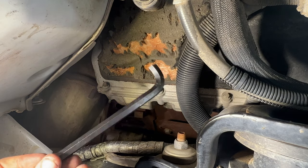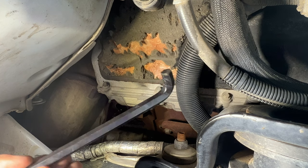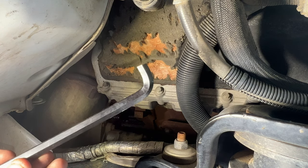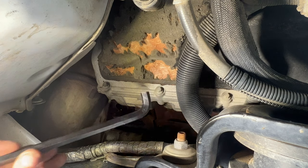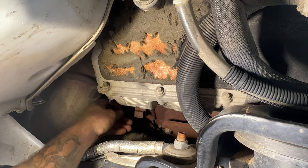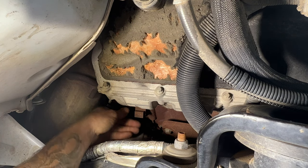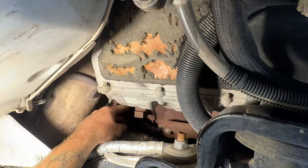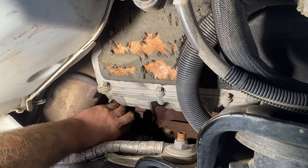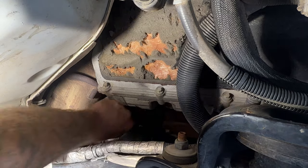So it did loosen up a little bit at least. Got an old junky 3/8 Allen head, and I went ahead and just cut a little bit off on the tip there. Let's see if that's enough to get it cleared past the starter — and it looks like that's going to work. I'm not sure if I'll be able to do it by hand here. Let's see if I can break it free now — it's still too tight on there.